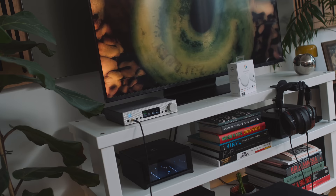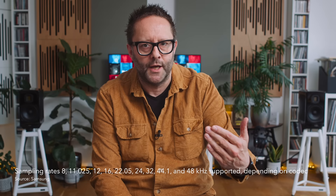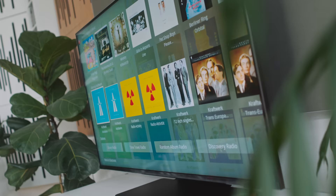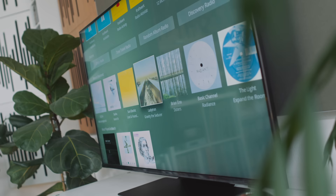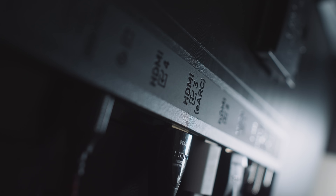Those nuances are sometimes downright irritating. I started by connecting my TV's Toslink output into the Toslink input on a MyTech Brooklyn Plus DAC, because the MyTech will report on the sample rate coming in from the TV. I did streaming from Plex, Spotify, and a bit from Tidal, and all the time the MyTech front panel said 48 kilohertz. So clearly the Tizen operating system that runs the Samsung TV is resampling all audio to 48 kilohertz — no high res for you. It means you get CD quality audio, but it's upsampled to 48 kilohertz. Basically, if you want a bit-perfect streamer, a Samsung QLED TV is not for you.